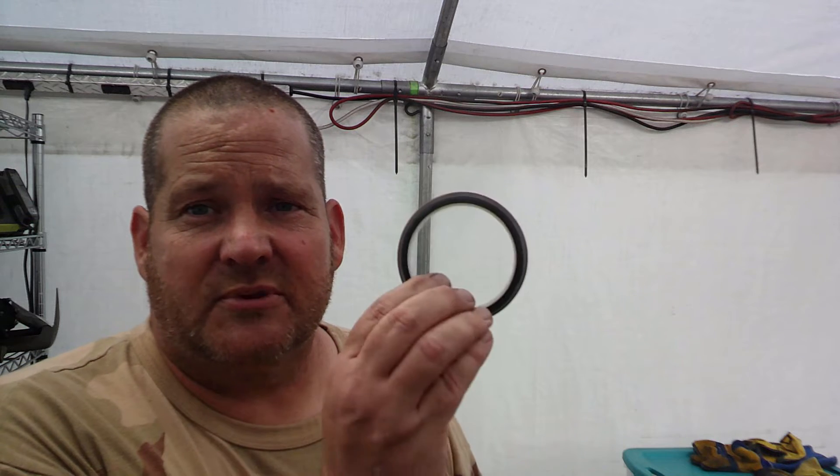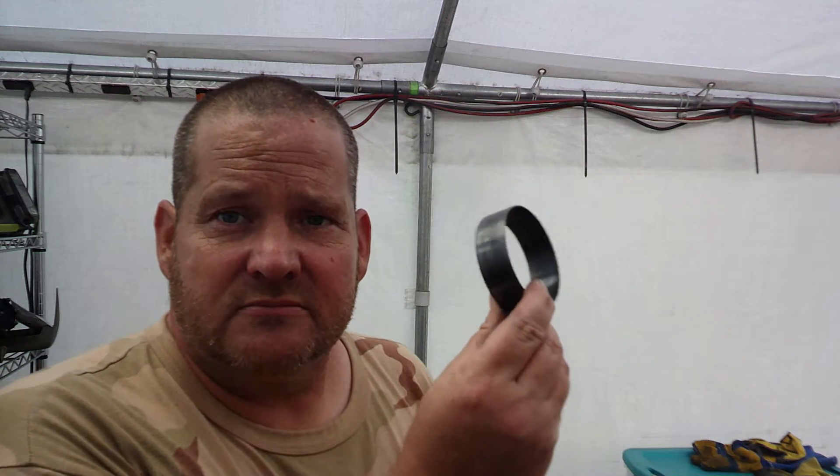It's mandatory at this point. My seal kit came with a little collar that's supposed to go on the outside of the timing cover to set the depth where the seal should go. We've also got the seal itself with a little plastic spacer ring on there — we'll cover that a little bit later. And it also came with a repair sleeve, which I ordered before I took everything apart and realized how bad the end of my crankshaft is.